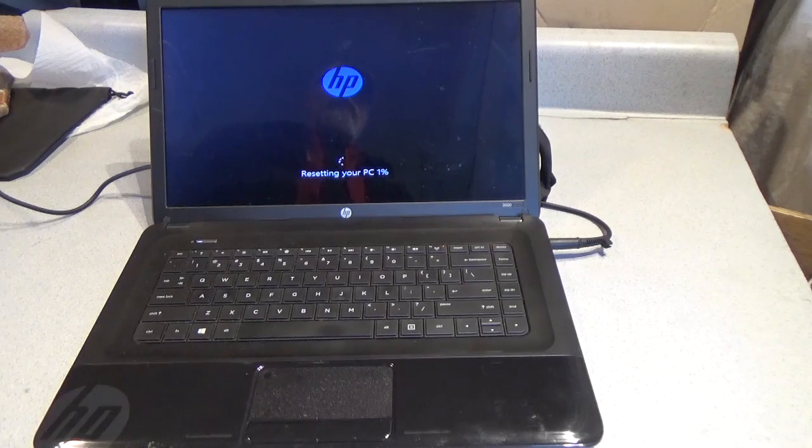When you put something in the recycle bin, when you delete something off your computer, even though you think it's deleted, it's not really. And this is why someone with third-party software can get into your computer and recover those files. Because when you choose delete, all it does is tag those spaces associated with those files as being available if they're needed. If the computer doesn't need those spaces, the files are not deleted.